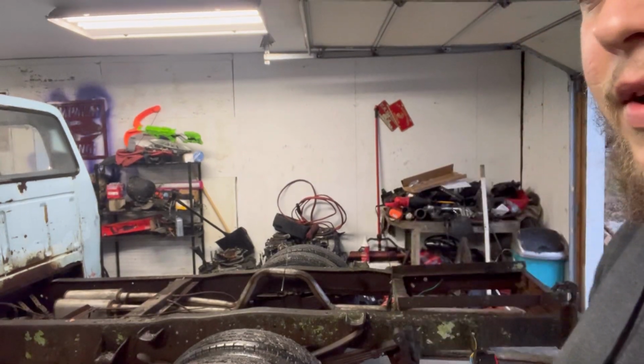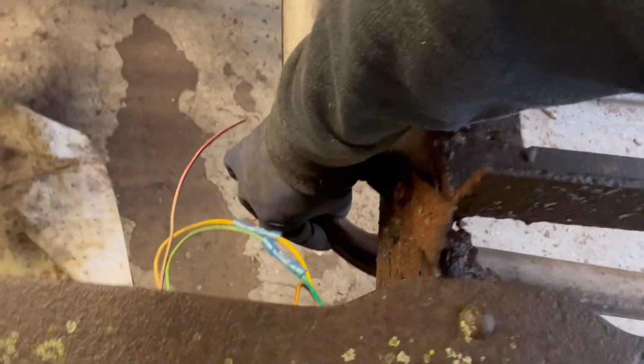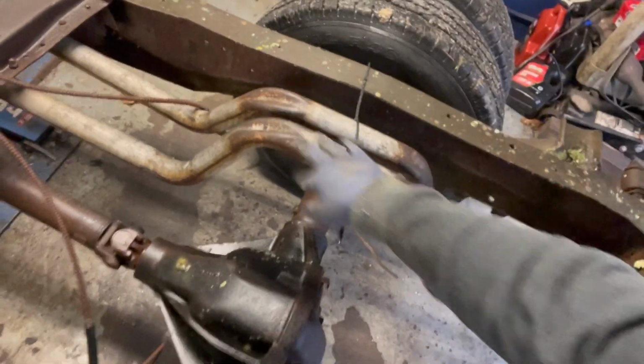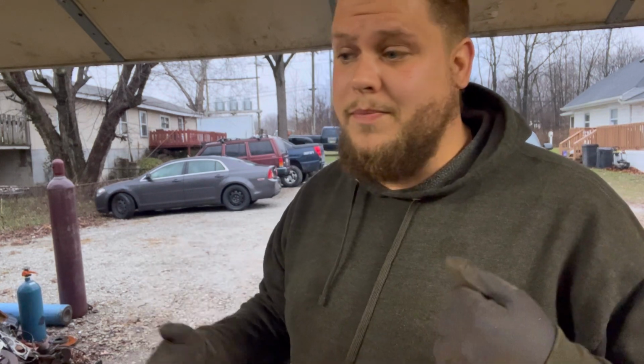And if you look at the bends on this exhaust, I know this was done in the 90s, but every single bend, can you see that? There you go. Every single one of these bends is pinched flat. That's how deep my fingers go into that crease. You can see it back here too. Every single bend on this exhaust is pinched flat. So I don't know. Plans are a 4-barrel intake with a 4-barrel Edelbrock 1405 manual choke.